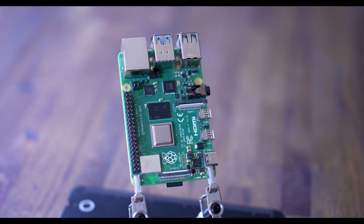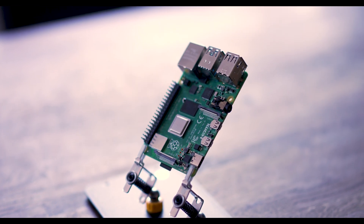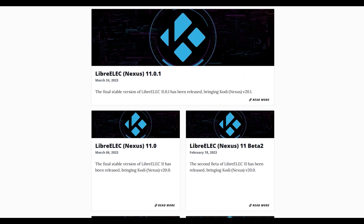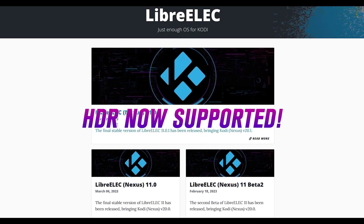Number 5: a discrete media server. The Raspberry Pi 4 is small but has great potential. The Raspberry Pi 4 can make for a nice invisible media player. It's capable of outputting 4K at 60Hz and can do hardware decoding for HEVC or H.265 files. You can easily install Kodi with LibreElec as base OS. Then you can hide away your Raspberry Pi behind your TV or in a cabinet and stream your movies from a network or USB drive.